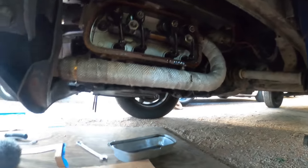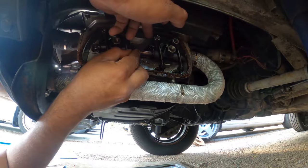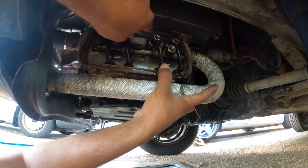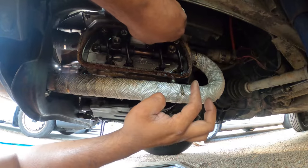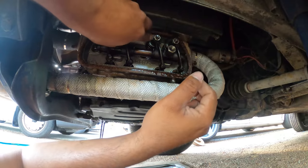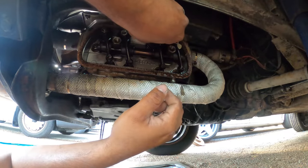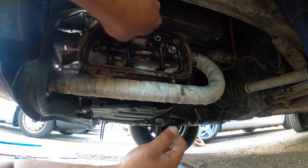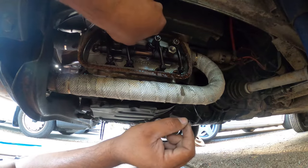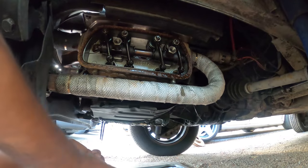So what we're going to do is do a quick test. I'm going to feel for the intake and exhaust valves to make sure they are either in spec or not. Right now intake is really stiff — I can't even get them in there. Exhaust is about the same. Now it's loose — they just go in no problem and they have no resistance at all — they're loosey goosey. So it's been a while since I've done my valve adjustment, so good thing I came with the proper tools to do it.